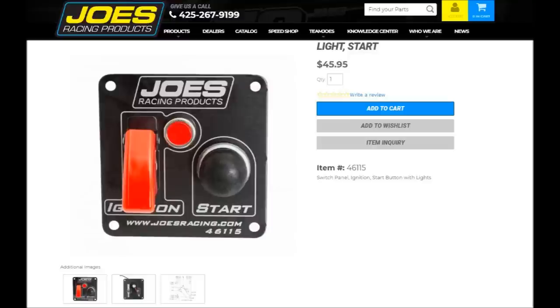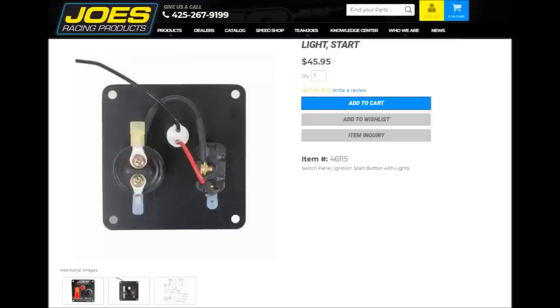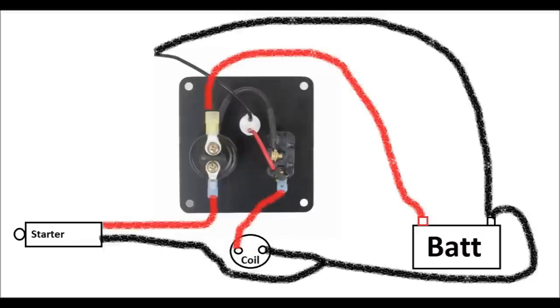But you can swap out that switch and make it work — you'll just have to buy one of those switches. So I made a quick little drawing. Here is the thing he's looking at, and here's the back of it. So I made a drawing of how you would usually connect this. As you can see, the battery feeds the switch — at least the push button switch. The push button switch then feeds the toggle.